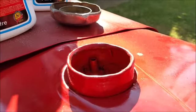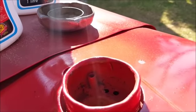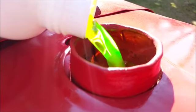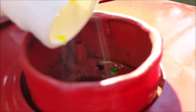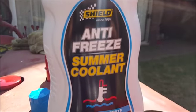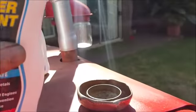And then lastly, when I took the probe out, there was a little bit of rusty water that came out — probably 50 milliliters — and further it was clean, clean water, which is a good thing. So I am going to put some anti-freeze in now. I'm going to put this full liter in — that is about what I have lost.